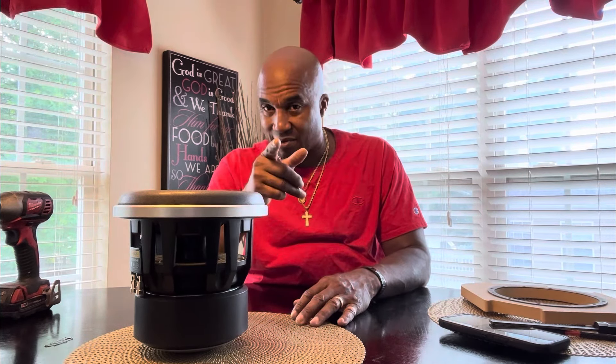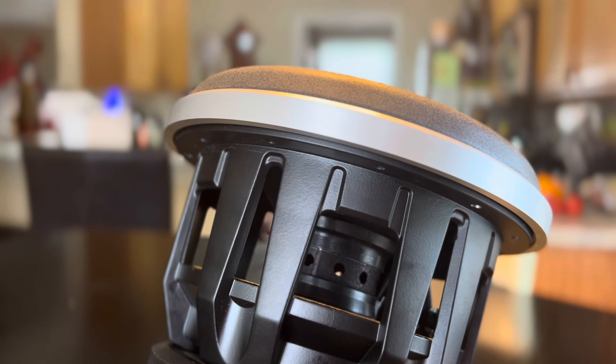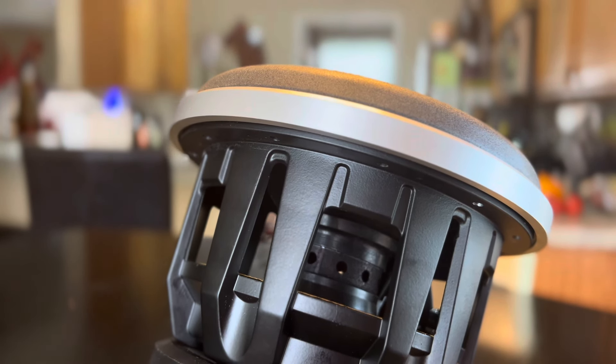Let me show you what JL does. Okay, two things we're going to look at while we're on the inside of this woofer. First, remember the triple joint — the cone, the spider, and the former coming together as three pieces. Well, there are two manufacturers that don't use that approach. JL is one of them. This enables them to get a greater X-Max from the top piece, and they don't have a triple joint. What they actually have, you could call it a double joint.